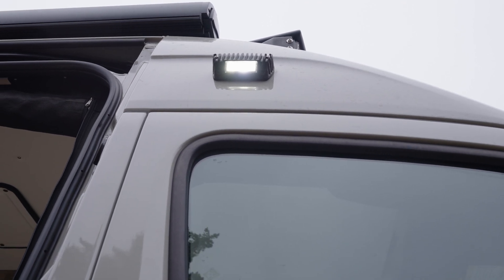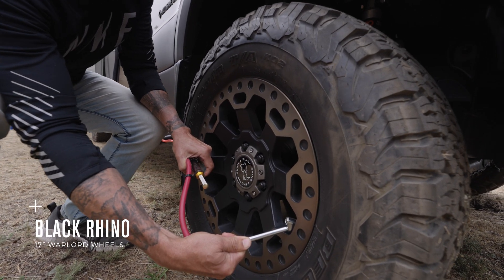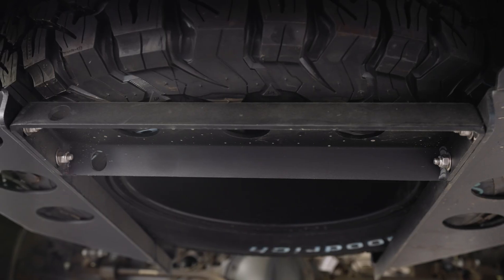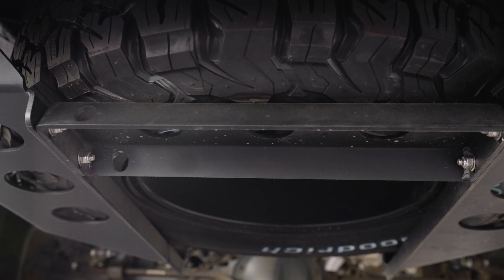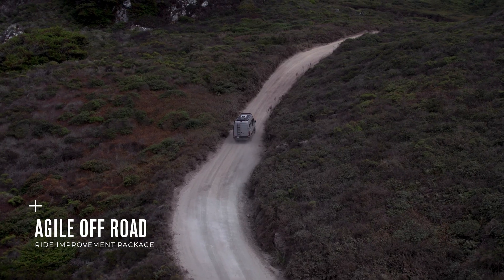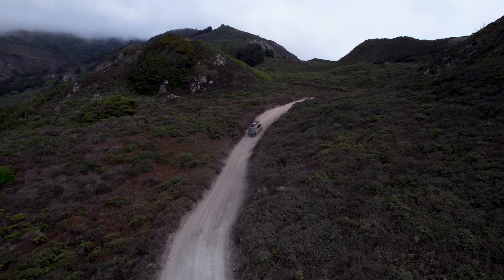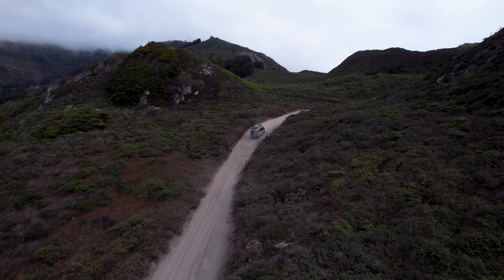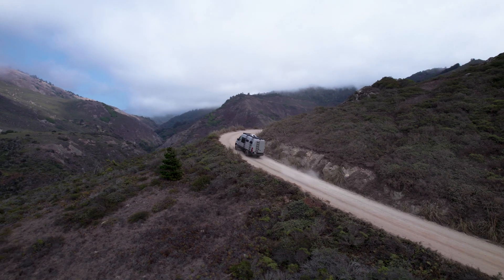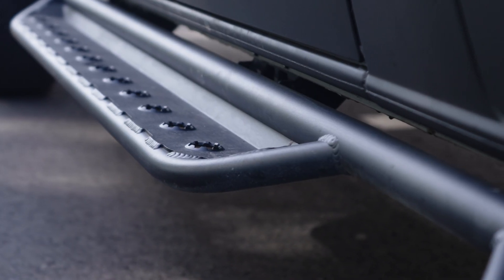When exploring off-road, Black Rhino Warlord 17-inch wheels with BFG KO2 tires provide the stability and traction needed for just about any terrain. To hold the spare wheel and tire, we've installed an undermount spare tire carrier specially made to accommodate larger diameter wheels and tires. With the inclusion of Agile Off-Road's Rip Kit, which optimizes the suspension setup around the van's total weight and load distribution, we are able to maximize the van's usable suspension travel while increasing stability and comfort on bumpy roads.